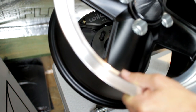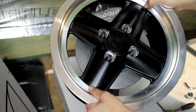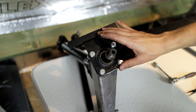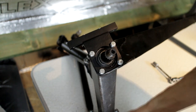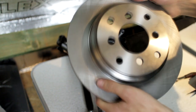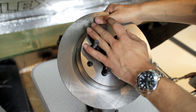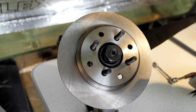This is a 260 millimeter disc from a Honda Accord or Prelude, which needs a very small modification before we can use it. I tried quite a few different discs before I found one with enough clearance for the caliper. Again, this kit you are able to use a 13 inch wheel, however not the original one — you will need a wheel with at least 320 millimeter internal diameter. You can see this kit really fills up the wheel. This kit will be perfect for someone who doesn't need a parking brake — essentially a car for autocross or track, a race car. This will fit in a 13 inch wheel without issue.